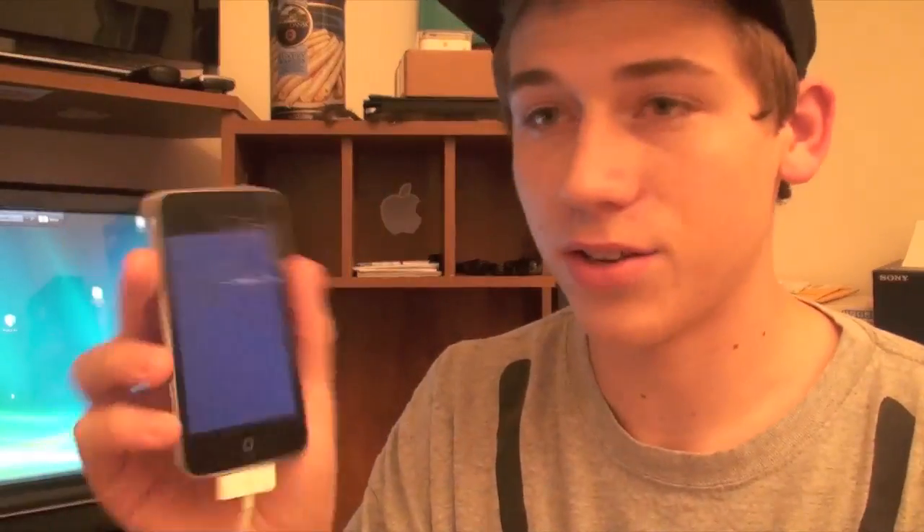Just be patient and you should get some pictures and images come up on your iPod or iPhone telling you everything it's doing. If it doesn't work, your iPod is going to show a black screen and be stuck on it. I tried this twice and it didn't work, so I thought it would be good to throw in the video. It does work though. If you get this problem, just hold the home and power buttons and your device will reboot in a few seconds. Wait for the Apple logo and your device will be fine.